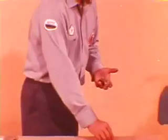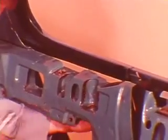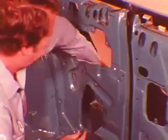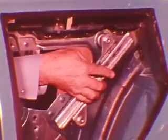Let's say you got a car back from the bump shop and go from there. Put the upstops in first. Put the nuts on, but keep them loose. Install the lower sill bracket. Keep the screws loose. Put in the pivot channel. Tighten the 2 bolts.